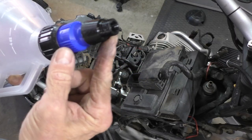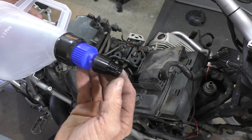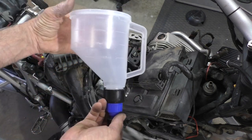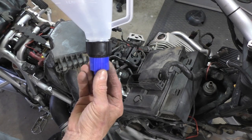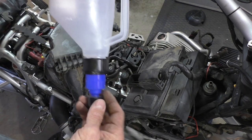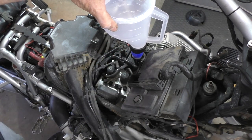I made this — the part right here is 3D printed. It's a portion of a larger file available on Thingiverse and I'll post a link. I put epoxy in there and set this in overnight. This part I found at an auto parts store — it holds a whole quart and has a valve built into it. When you rotate it, it's open or closed. This will screw right in to where one of the plugs is, and I can watch the fluid level drop as I do the bleed.